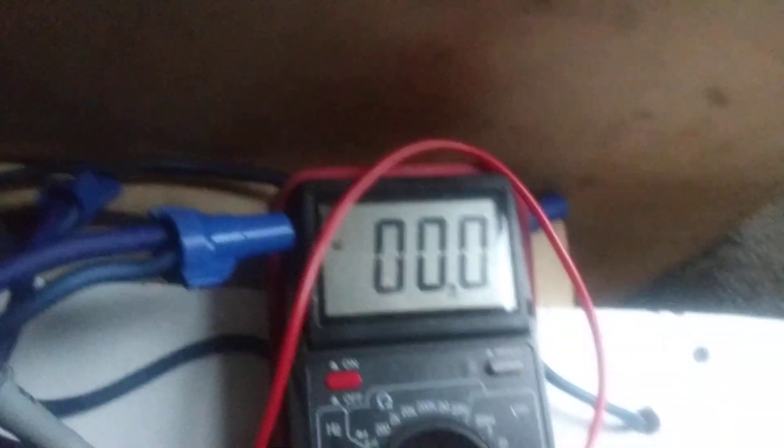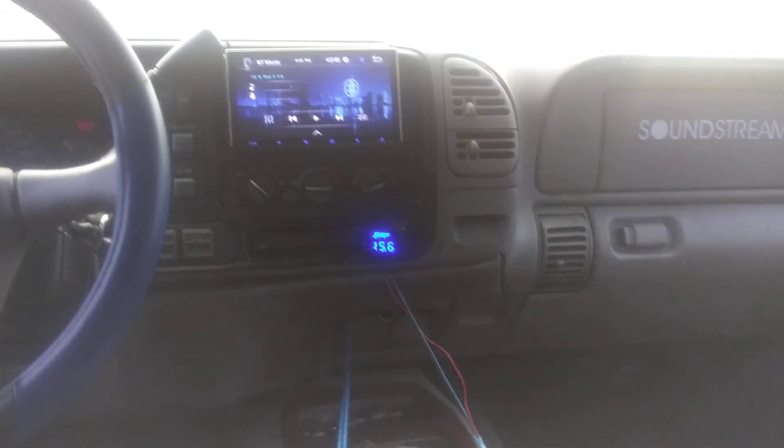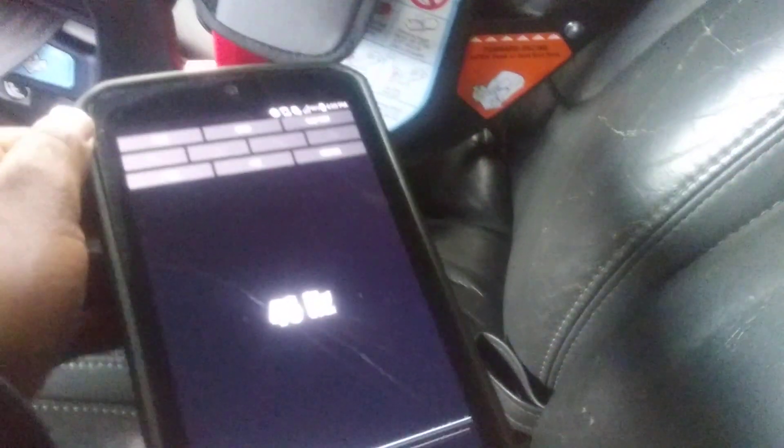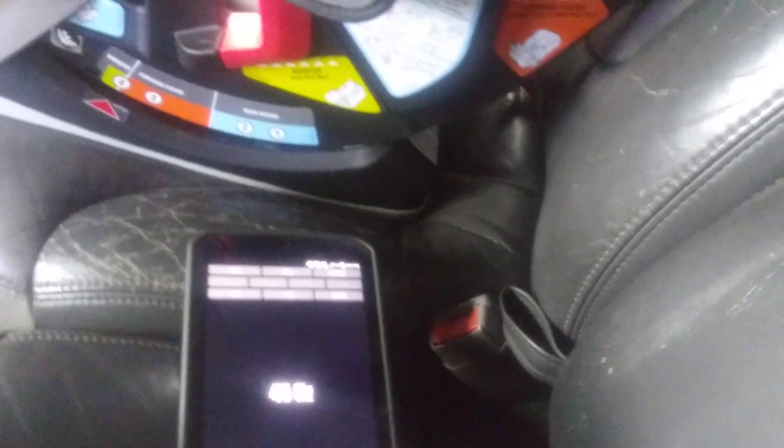Right now I'm clamping them — I'm just curious to see what kind of power I get out of them. My voltage is resting at 15.6 volts. I'm running the test off my tablet with a tone generator downloaded from the Play Store. I'm going to try 45 hertz, 40 hertz, 35, and then 30 hertz. This is a custom bass knob I'm using — my Batman bass knob.